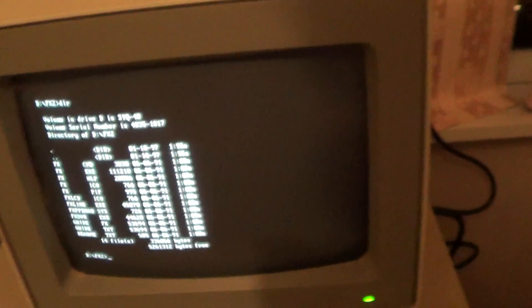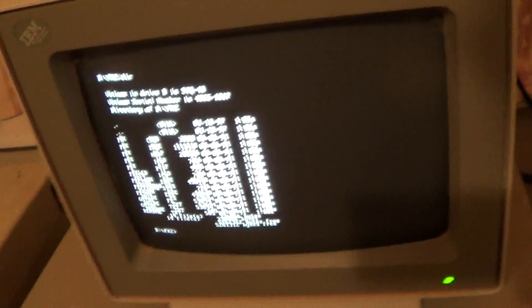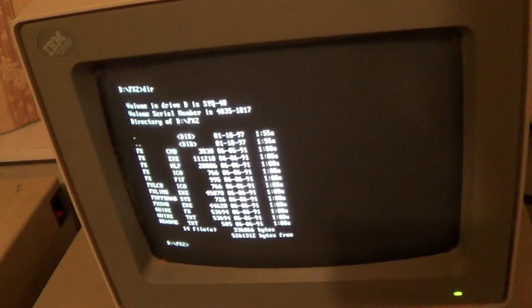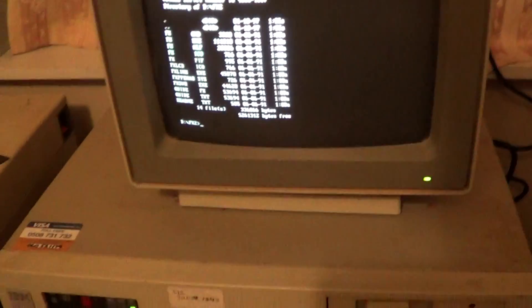This little machine has got 640k of RAM and 2.5MB of extended. I fitted it with an EverEx 3080 RAM Deluxe — it's pretty hardcore. It's got 12 banks of memory on it, and each bank is either 9 or 18 chips. It's the full height and full length of the case, just row after row of chips.